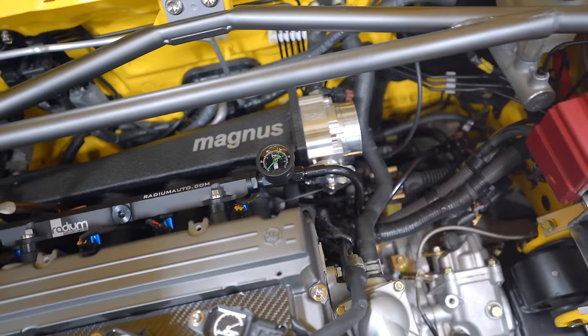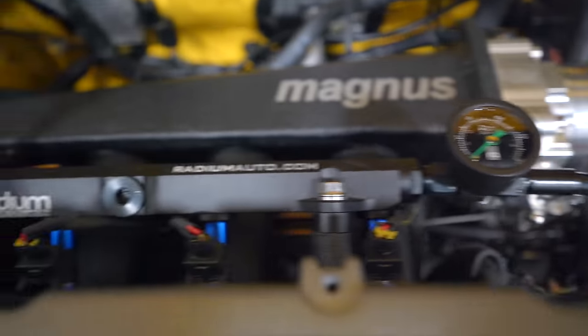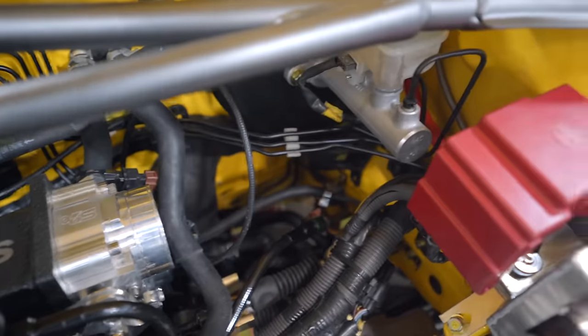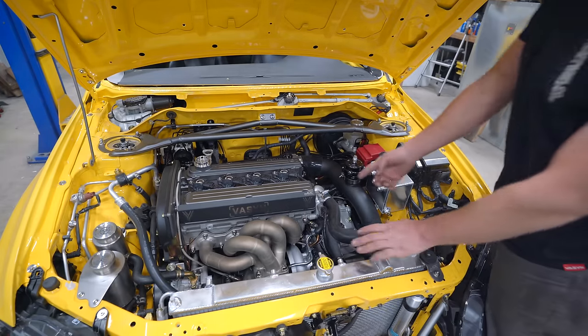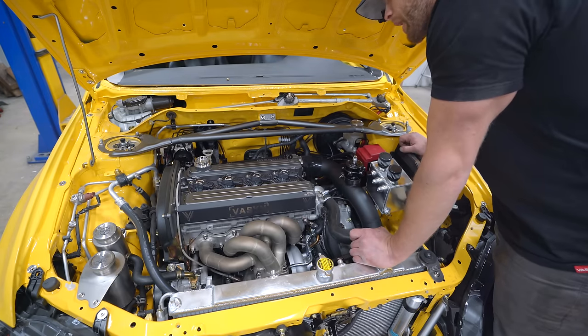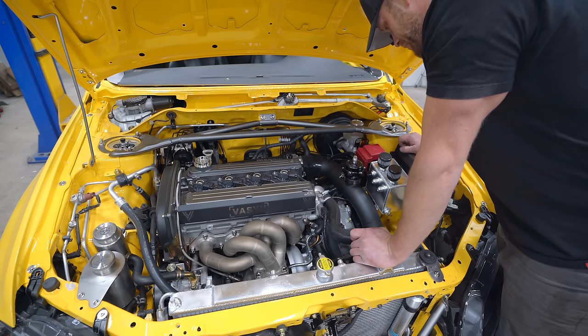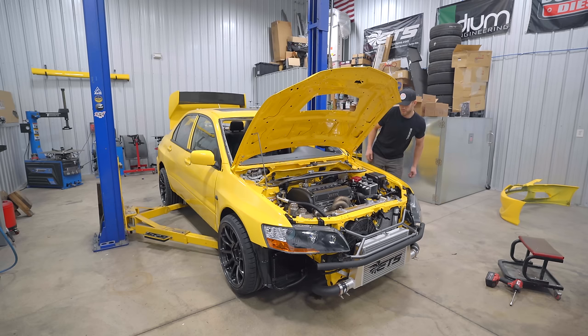So here's the final setup with all of the Radium parts. We have the Radium adapter line kit going into the gauge, the Radium rail comes out the other side into the direct mount regulator, and then back to the line down there. The bay is 99% complete - the only thing missing are the valve cover and hoses, and we just need one more adapter for the driver side. Let's fire this thing up, dial back our fuel pressure - before it was at 60 psi which is way too high, so dialing that back should clean up some AFRs. Just making sure we ain't got no fuel leaks right off the bat. Should be good.